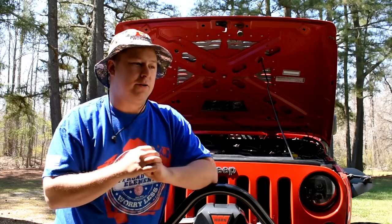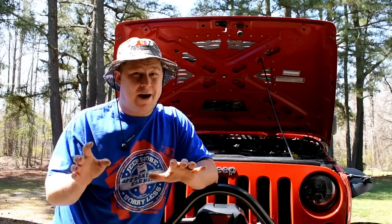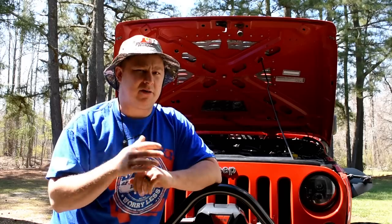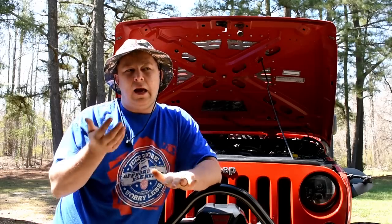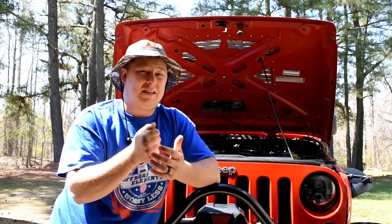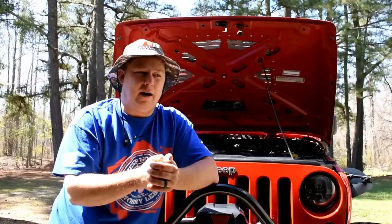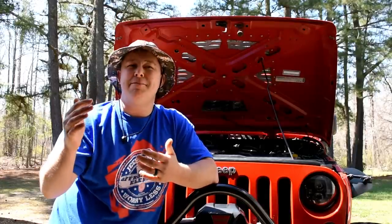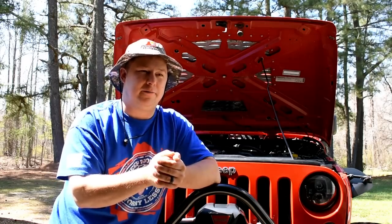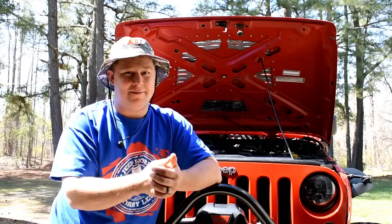For 40 bucks, definitely worth it. I've noticed the throttle response is a lot better - you get on the gas and you notice it instantly. I'm not going to say it adds a whole bunch of power, because it doesn't. But it's noticeable right off the throttle with the response. Above 3,500 RPM, you really notice the engine just wants to keep going a little bit stronger. It's not a true cold air intake - the aluminum absorbs heat. Some of the more expensive ones with fancy plastic might draw in cooler air since it won't heat up the intake pipe as much. But for 40 bucks, I'm impressed. Which almost makes me believe maybe the $200-$300 ones are worth it - you might get even more performance out of those.